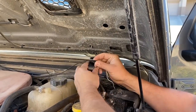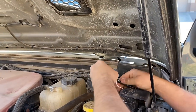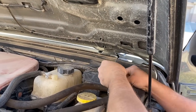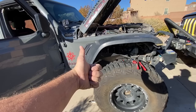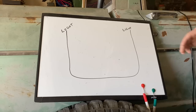When it's all said and done, just make sure you wrap up all your wires together, whether in a wire loom or electrical tape, to really clean up the look and help protect the wires in the long run. Now that we've got this all done, I'm going to put my inner fenders back in, make sure everything's tightened up, and we'll wait for nightfall to test it.